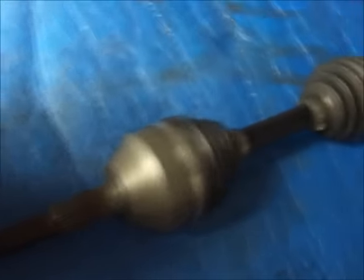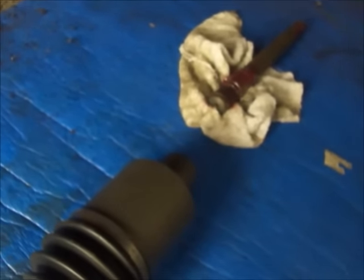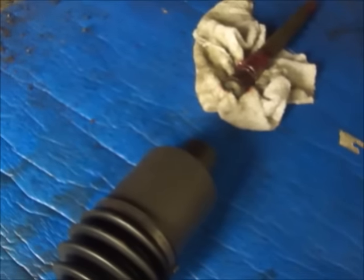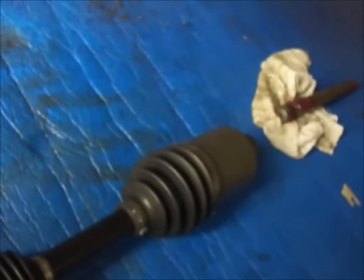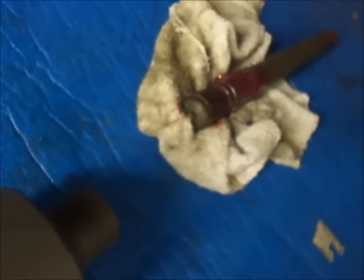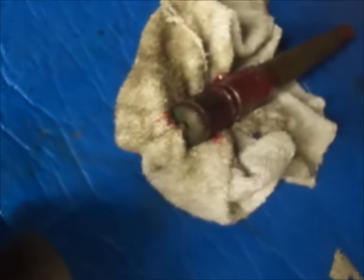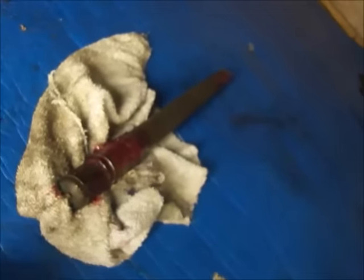Here's a remanufactured axle, came with the CV joints. Luckily Brian, the alignment guy, knows a guy a few towns away that rebuilds these. It's a $250 axle from Chrysler — this would have been over $600, he was telling me. When I took this out, it was seized right in there, as loose as it was. There's a spline setup that goes in there and interlocks. I'm going to grease that up really good, but I'm going to put that first part in first.